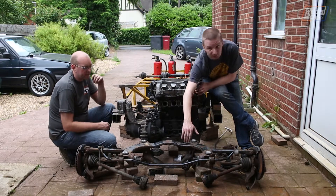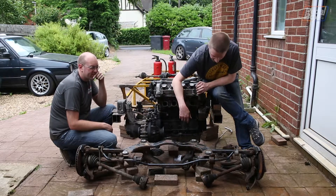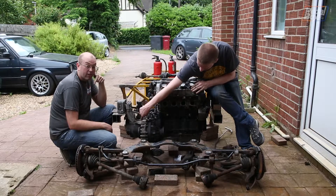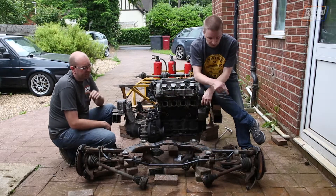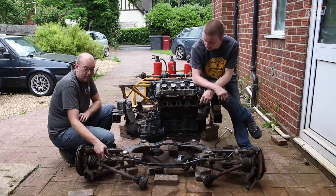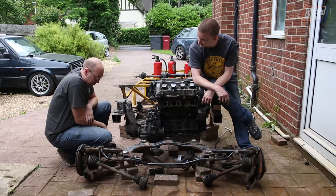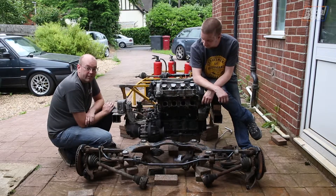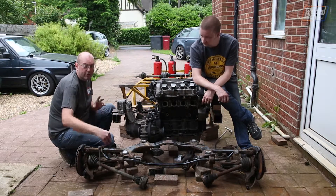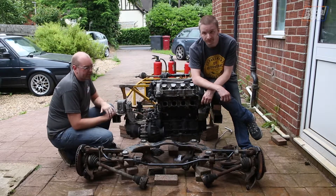Major problems we have is this subframe wants to be inside our differential and sump — and that doesn't work. These upper arms want to be inside our sump and gearbox, and that also doesn't work. The anti-roll bar actually clears everything — it's the only conveniently located piece on the whole thing, aside from this mount. What it does mean is that we don't have to build out a huge distance from the back of here to get down onto the mounts. The thrust of everything goes through the chassis, which is generally better.